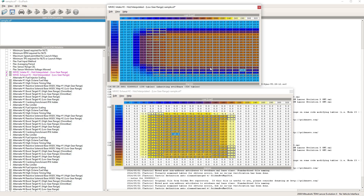Sometimes I'll reduce this even more just to get more boost on top. For spool on a stock turbo, you really don't need anything more than negative 10. You can go more aggressive — it'll kick a little more and give you more torque down low — but depending on the client and how they drive, I adjust this. On large cams, you don't really need negative MiVec.